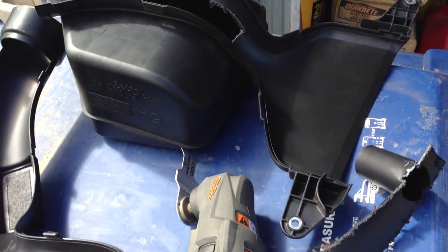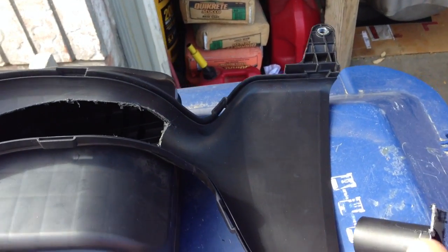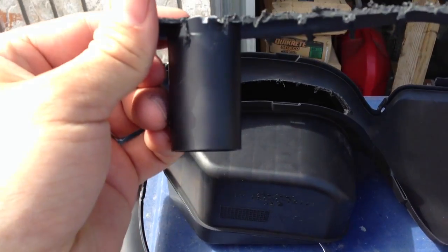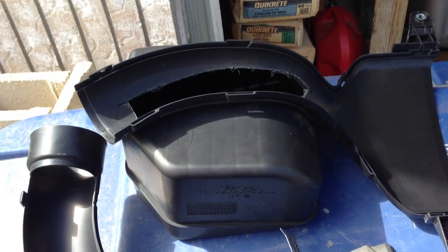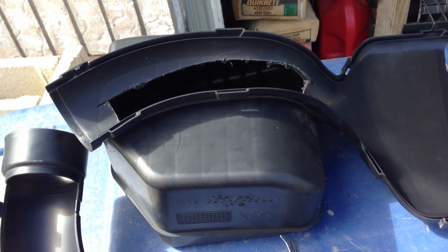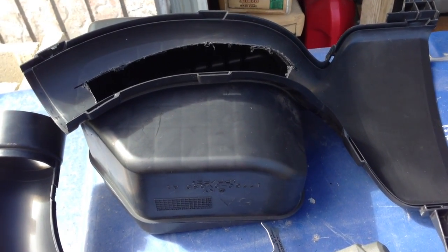Okay, we're back. So when I made the cut, it just cut the inside out. Now we can go through an explanation of what a bellow box is for. A bellow is basically to quiet down the intake by this little pipe going inside this volume of air, passing over the intake air, causing it to quiet down and actually cancel out the intake noise. Now, some people want it quiet, some people don't. I don't care, honestly. I'd rather have the extra mile per gallon that this costs you. It really does cost you a little bit in MPG.